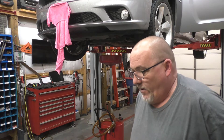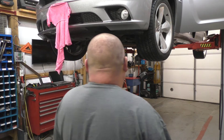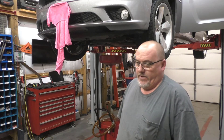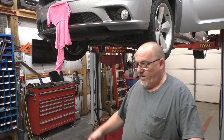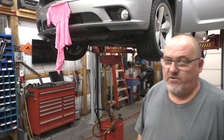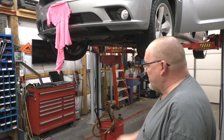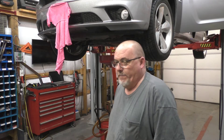What this came in here for: there's a check engine light, P3497 — that is the cylinder deactivation system on bank 2. As far as the individual who fixes their own stuff, there's not a whole lot you're going to be able to do unless you have a professional scan tool.